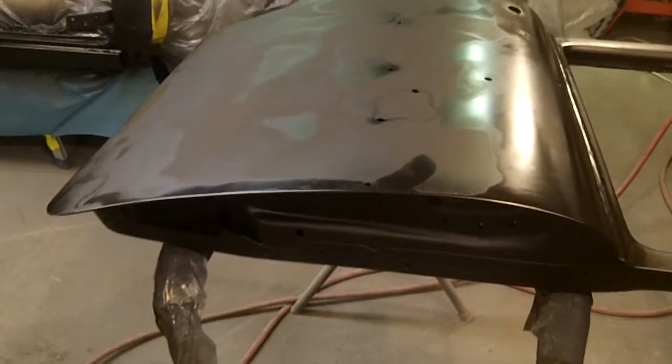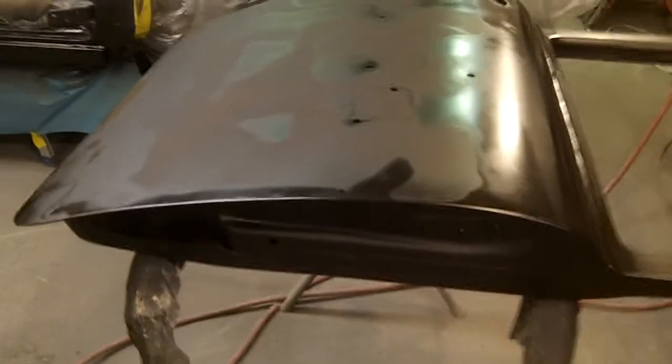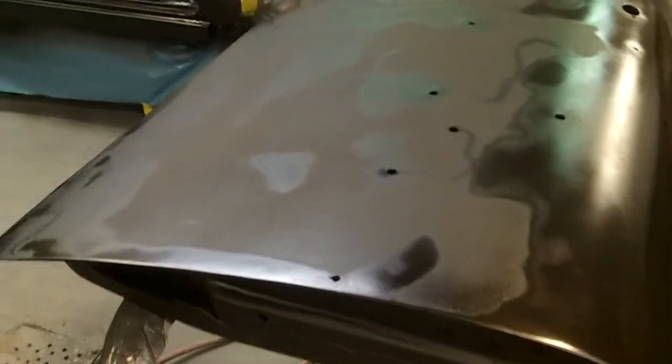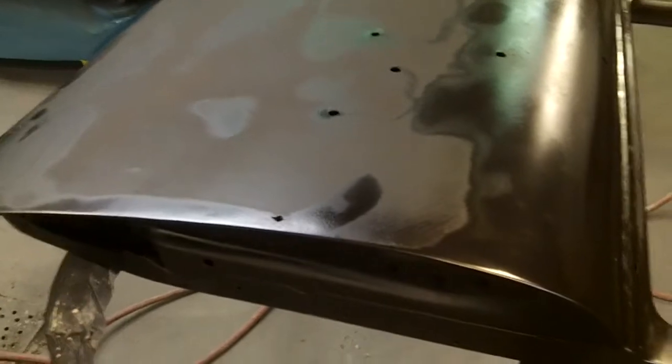But it will all have a skim coat because it's a 60-plus-year-old car. There was a metal patch in this corner, and a metal patch in this corner, and the rest of it was just kind of wavy gravy. So you can see from about that trim line down, it got a skim coat of fiberglass, and then a skim coat of regular Rage body filler, roughed out in 80, DA'd with 180, and now it is going to go in 2K first round.